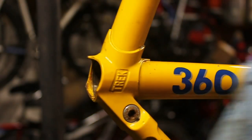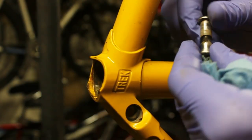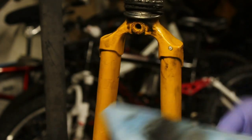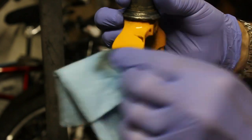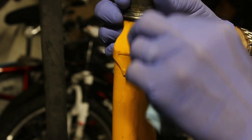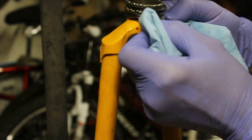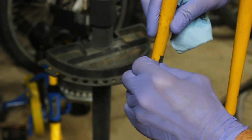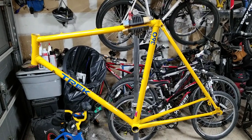Once I have a naked frame, a full cleaning is done. My standard go-to solution is a mixture of mineral spirits and gasoline to remove dirt and residue, followed by a cleaning with isopropanol. I don't use a half-and-half mixture — it may be about a 60/40 or 70/30 ratio. I don't use a lot of gas because it will chew up plastic and is corrosive to certain paints, but it's really good at getting off the gunk. The isopropanol is very clean — basically rubbing alcohol.